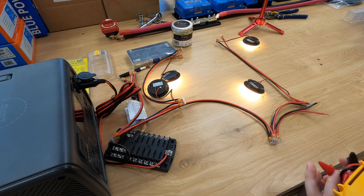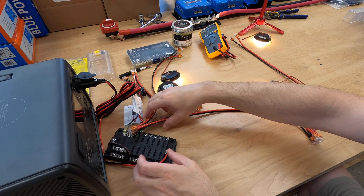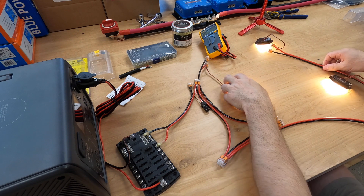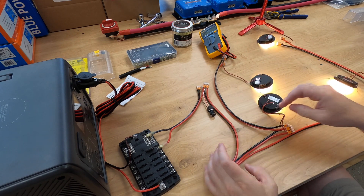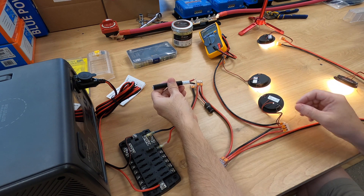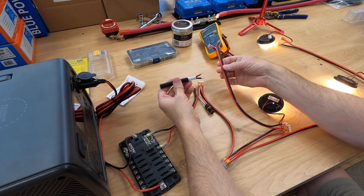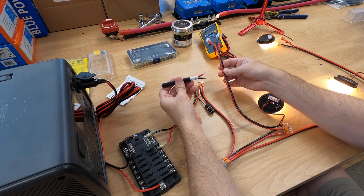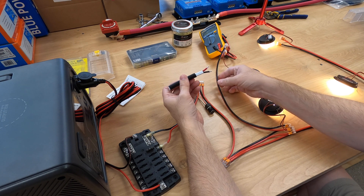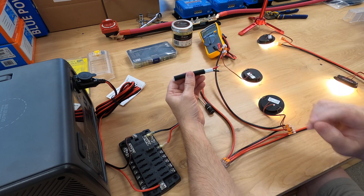Obviously the wiring is going to cover a lot further distance in a van, so be aware of that. There are a lot of calculators out on the internet that will help you determine your wire gauge for your length. The most important reminder for me: I see so many people out there using individual red and individual black wires not even together, and that's got to be messy when wiring your van. You really want this extra protection — sheathed, and then loomed.